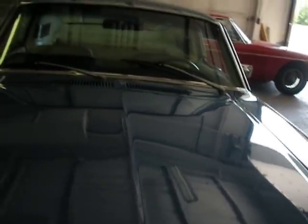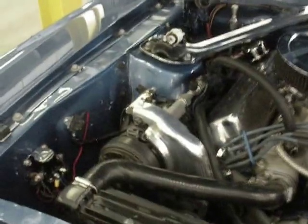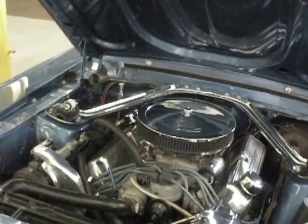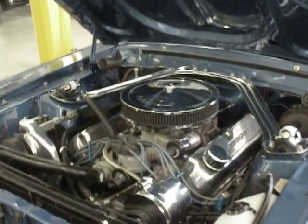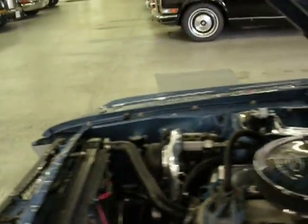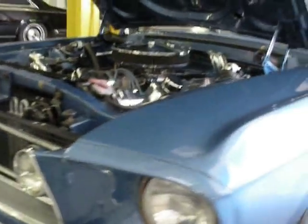Take a look up under the hood — the car is very tastefully done. Under here we have aftermarket add-on air conditioning and chrome appointments. It's running a serpentine belt. The engine is a 351 Windsor punched out to 427. You've got MSV headers, a T4 transmission, everything built up, electric cooling fans to keep it cool, and an aftermarket light up front. The front spoiler is very tastefully done.